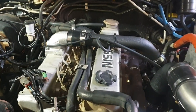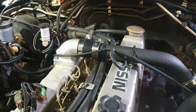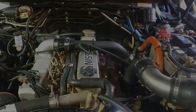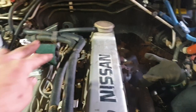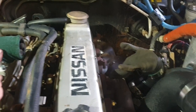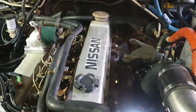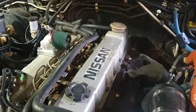With the area clean now — so don't get any debris inside your engine — remove whatever air intake piping you've got or your filter box to access the rocker cover. A little tip for any air intake piping: just bang a glove, plastic bag or something over it. Try not to jam a rag in there, sometimes you forget, which I learnt the hard way one day. Now let's just pull the rocker cover off — 14 bolts, 10mm.